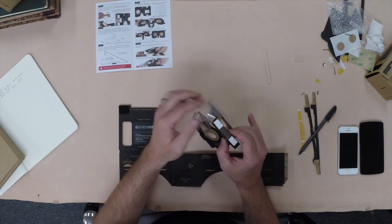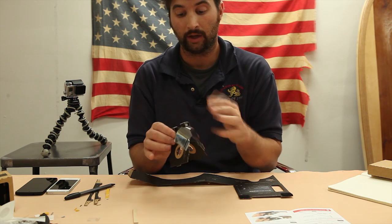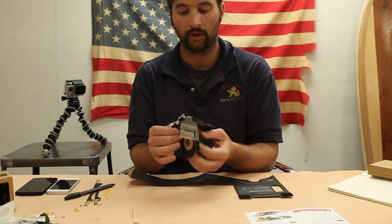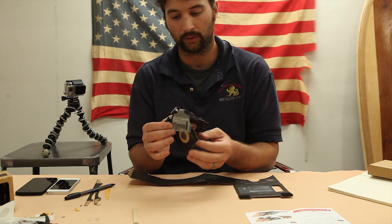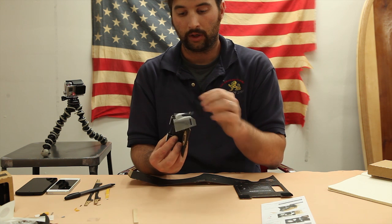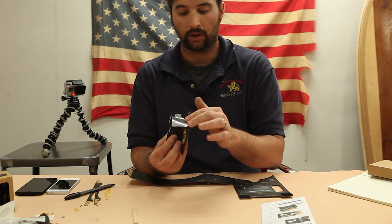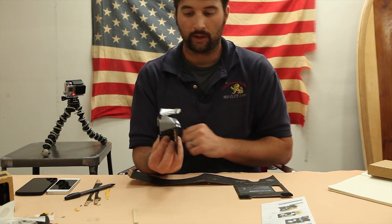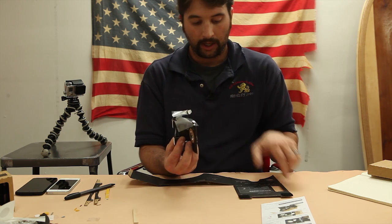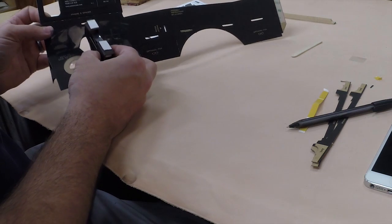So this piece is there to create the kind of capacitive touch event on your screen. This is a special plastic material that will interact with your screen and let the button mechanism work. So you'll notice those tabs, those slots in the metallic shield will line up with your tabs on the faceplate, and we're going to put this piece in here like so.